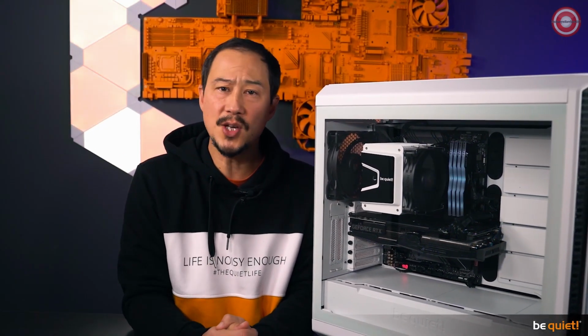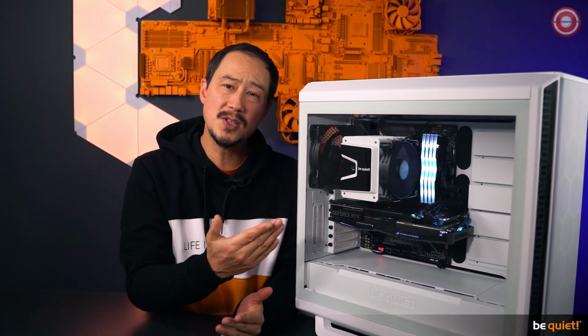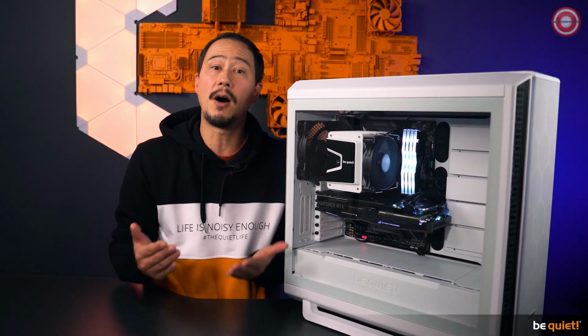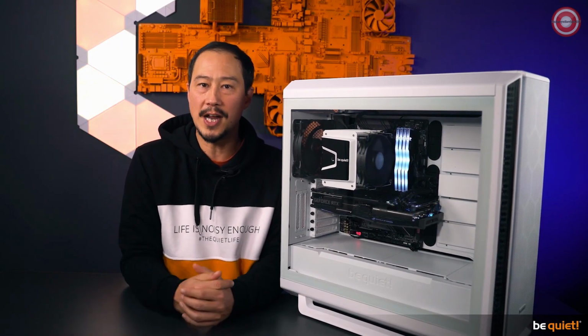It is up to the user to choose the best setup and to configure their fans so that the optimal balance of cooling performance and noise level is achieved. A water cooling system with a mesh front will rarely run at 70% fan speed. Here, an increase of just a few degrees will save you a lot of decibels. The air cooler, on the other hand, could spin a few paces faster until it reaches louder regions, which offers the opposite potential. But this is not the end of the configuration options.